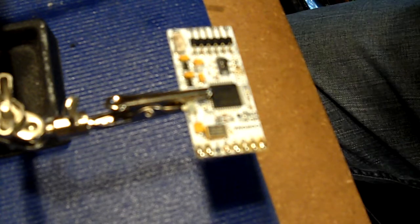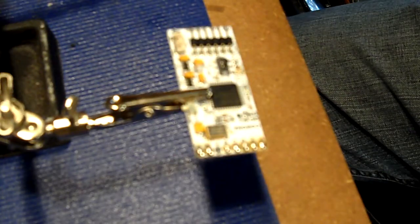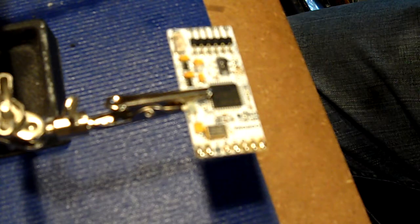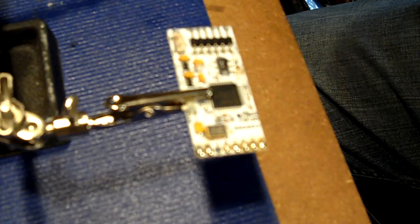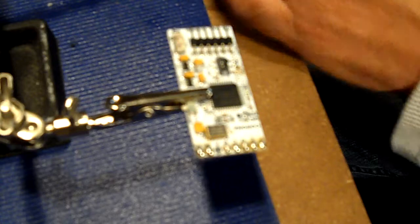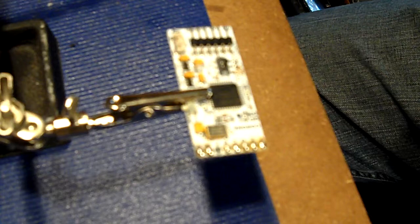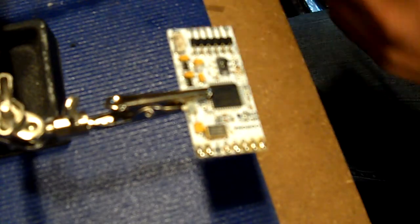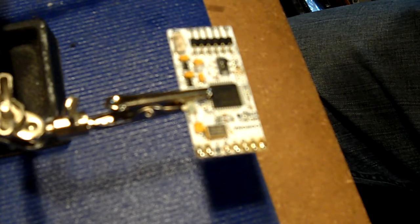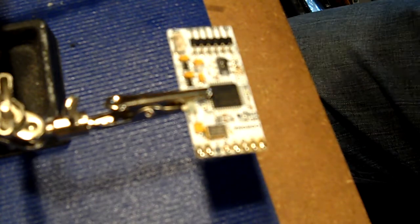There's our CPU reset cable right here, and it's our blue wire. And then we have our yellow post out, which goes to C. And we have our orange wire for our standby clock. That goes to pad B. Then we have our power wire, which goes 3.3. And then we have our ground.